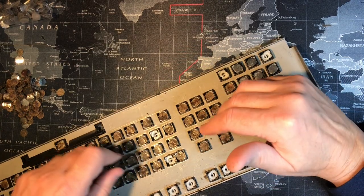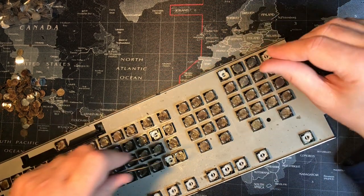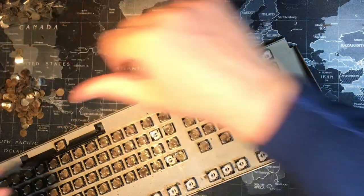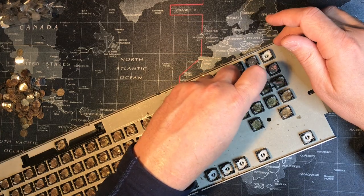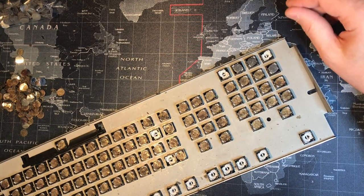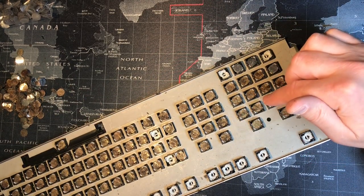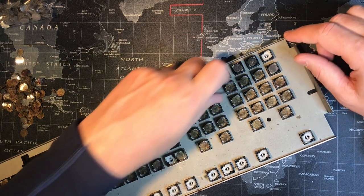Although with me making all this mess with the foam, that makes me want to take them out and clean them better, because the foam's probably getting everywhere, and since it is sticky, it's likely it'll get in the sliders and the casing as well. That's what would make me want to pop out the black part too, the casing, to make sure all the foam's out of the white sliders and the black housing, and then leave the metal, and I can clean the metal separately, and ultrasonic all the rest.